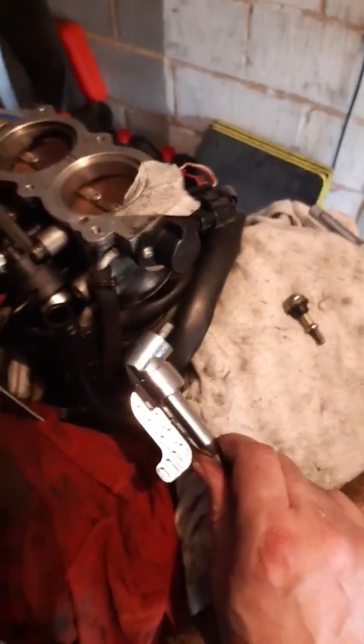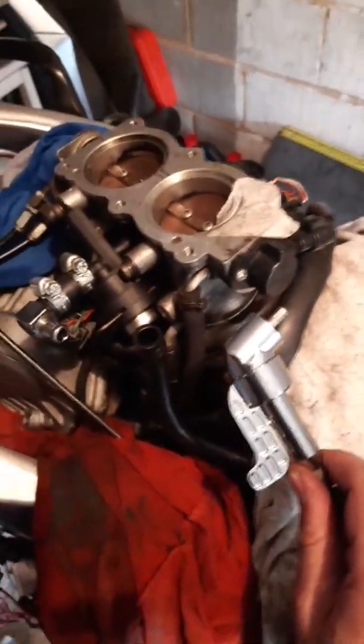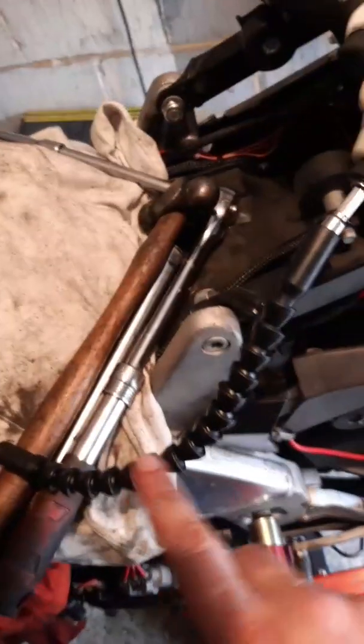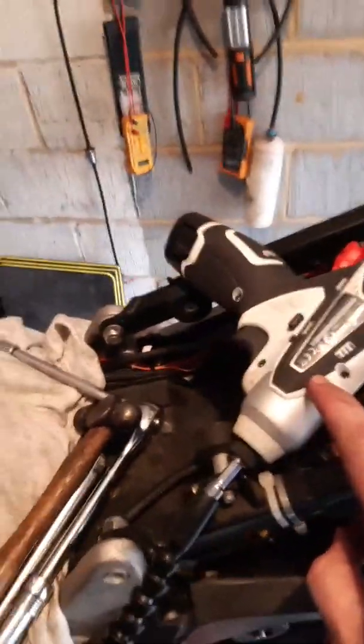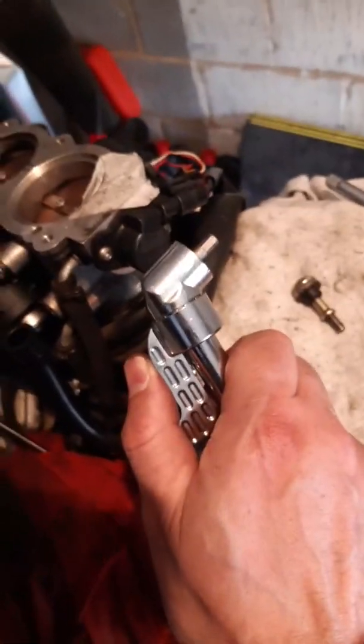And then, once I'd given it a bit of a shunt, I thought, right, okay, I'm going to use this adapter. I've got an almost 90-degree adapter that allows me to put an Allen key adapter on the end of it, a flexi drive, and then I run that into my rattler gun. Whilst I'm holding the rattler gun, I've also got the other hand free to apply a load of pressure on top of this adapter, and eventually it spun it out. I was really pleased when I started seeing that bolt moving. That did a really good job.